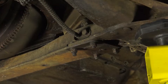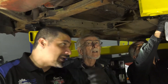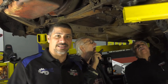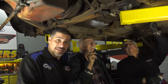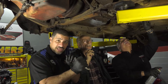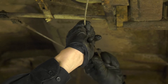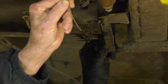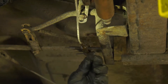We have to remove the emergency brake line that goes through the crossmember. It's got a threaded end with a lot of debris from 65 years of road grime on it, and we want to reuse it and keep the adjustment since everything on this car is still nice and tight. So we're going to spray it, loosen the jam nut, keep the jam nut where it is, and unscrew the end so we can pull the emergency brake through the crossmember. The hand brake part connects up top with a foot brake hook through the linkage.